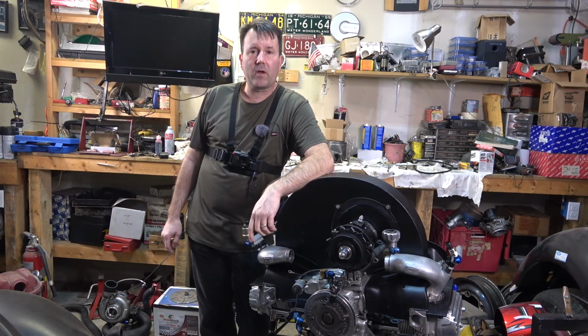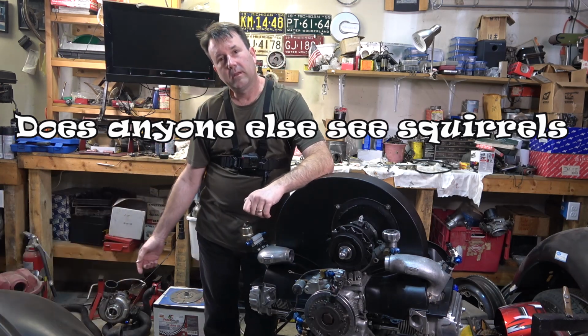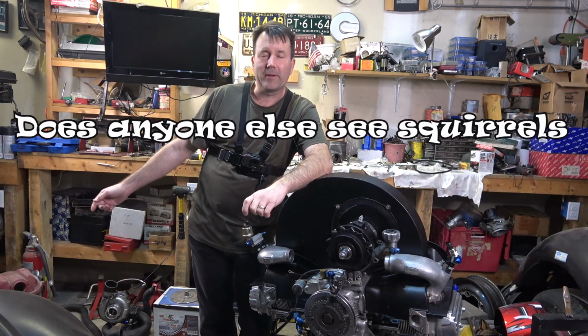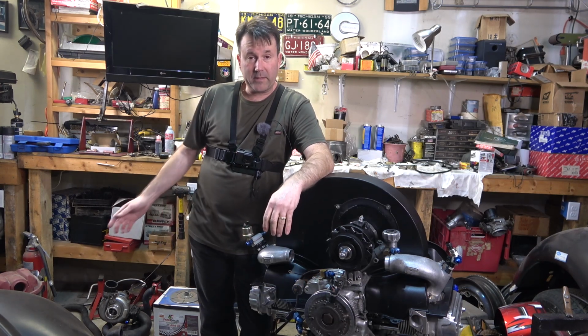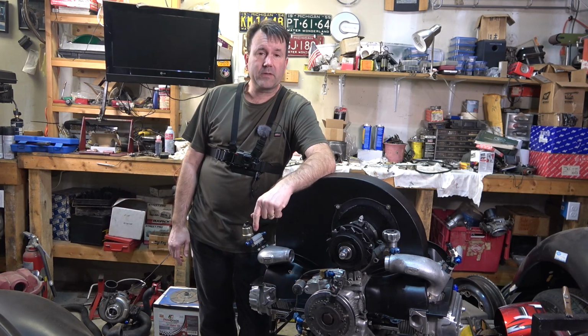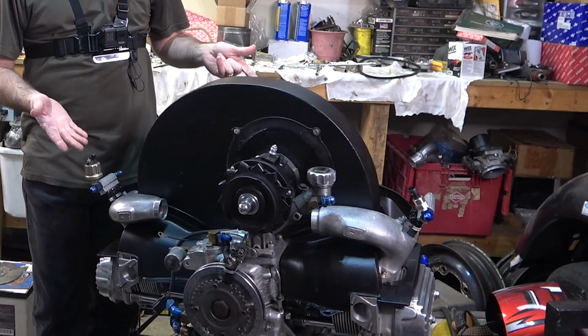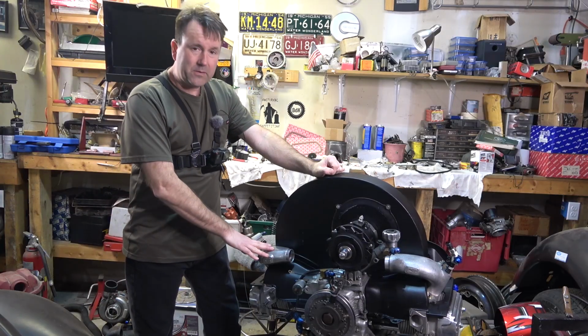But yeah, if you've been following along, you know that I've, boy, am I crooked? I look crooked. I have to replace or fix that here in a minute. I've torn it down to the short block, cleaned up everything, reset the deck height, put the heads on, reset the rocker geometry, and voila, we're back to almost a turnkey engine.